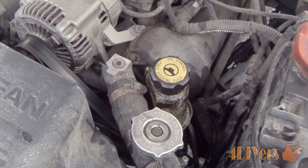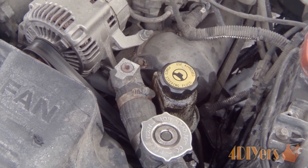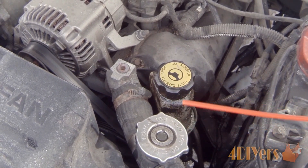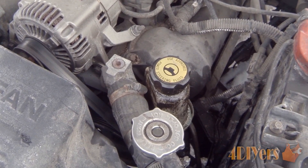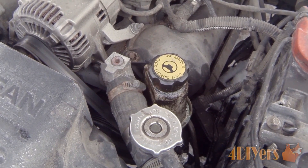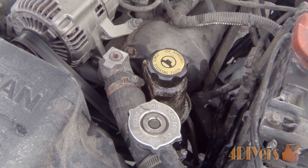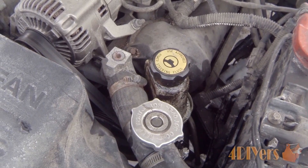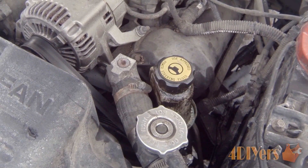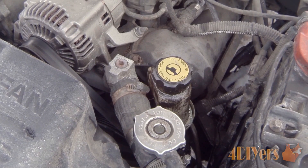As for the main parts of the system: the power steering pump and the lines, as I mentioned before. With the power steering pump we do have a reservoir that's built on top — sometimes you'll have a separate reservoir, other times it's built right onto the pump. As for the lines, we have the high and low pressure lines. Next we have an oil cooler. Not all systems have one, but this particular truck does, because when the pump is running it creates heat that needs to be distributed away from the system.